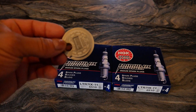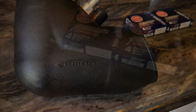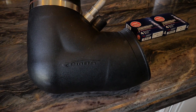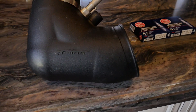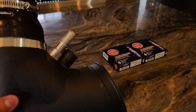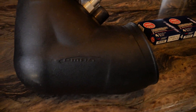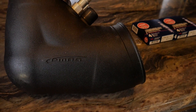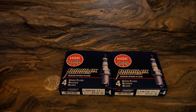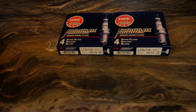These spark plugs are going to be gapped to .035. Here's my little gauge. It's always good to check the gapping before you put in a set of spark plugs. For NA cars, you usually want .049 to .053, which is what I believe Ford spec is for NA. But for boosted and nitrous applications, you want .028 to .032. You stick the gauge in on the thin side and slowly work your way up until it gets rough but not too bad, because you will open it up.